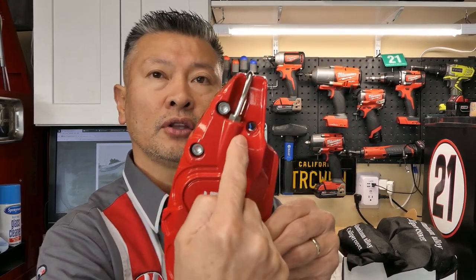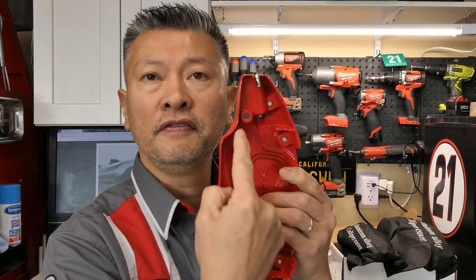Here's the very front of the rear caliper — you've got holes here and here. This is where you mount the back holding assembly that clamps onto the caliper, and you're tightening it to keep everything in place. EVBase gives you two finish options: silver or black, whatever your heart desires. Installation itself is not too complicated — just take your time. The fronts tend to be a little more difficult than the rears because you have three bolts to set up and the fitment is very tight, so you want to do it in a specific way.